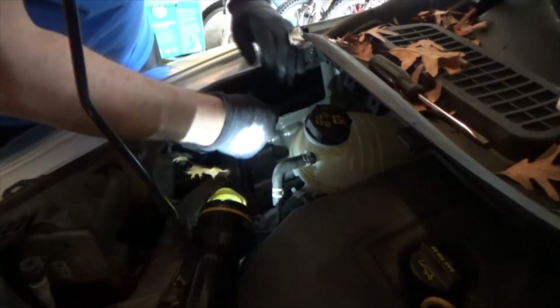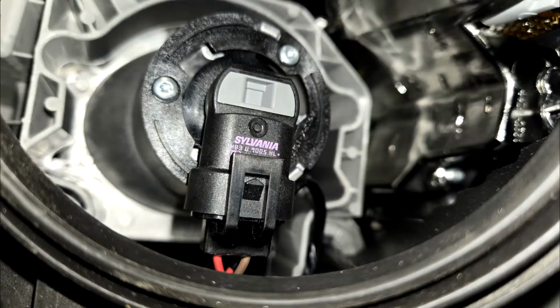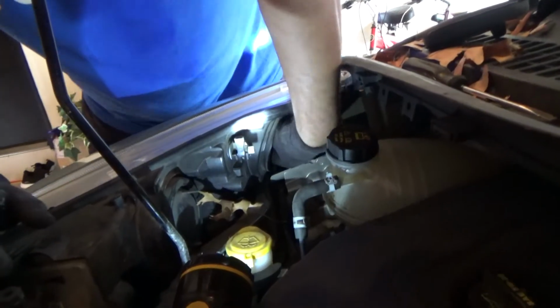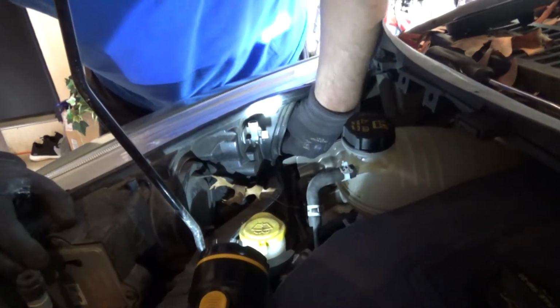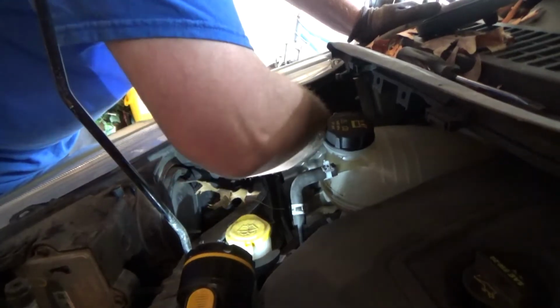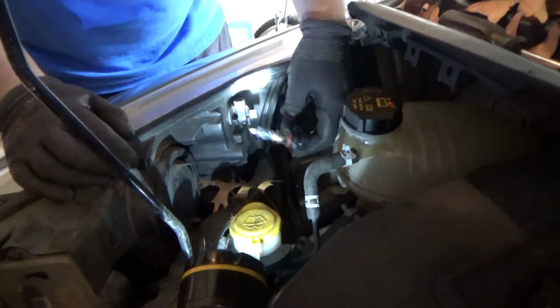So the next step, you just remove this rubber plug. The headlight bulb is over there, and normally you just twist it counterclockwise to unlock, and when you replace it you turn it clockwise. So stick your hand in there, grab it with your fingers. If you're lefty, that would be easier for you. Again, counterclockwise. Yeah, really tight spot, and that's what it looks like, just like that.